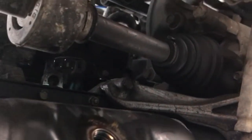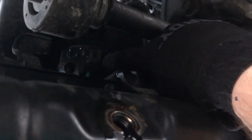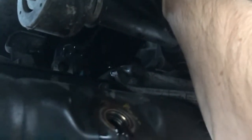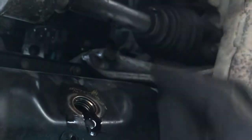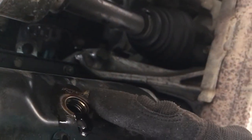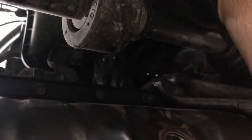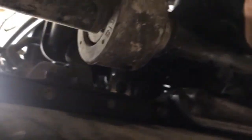I can show you where the oil filter is now. The oil filter is this shiny black thing that I can barely reach with my hand. Hopefully you can see my finger — it is this thing right here. What you do is grab it with your hand and rotate it counterclockwise. A smart thing to do is put the 17mm bolt back in when there's not much oil coming out — it'll keep you a little bit cleaner.